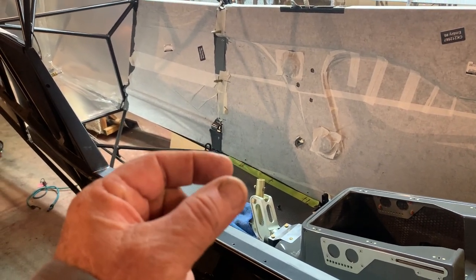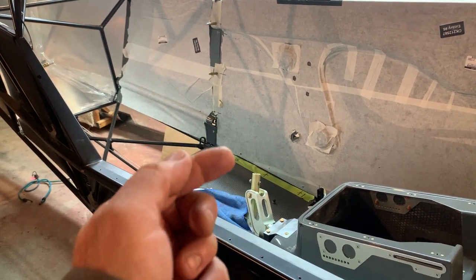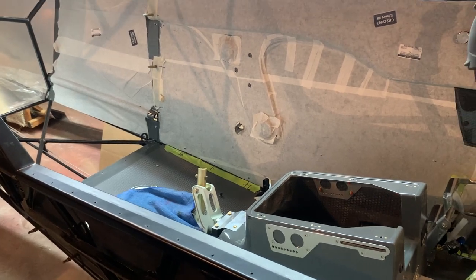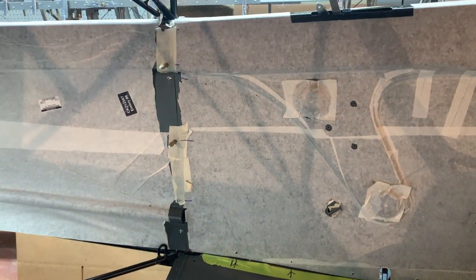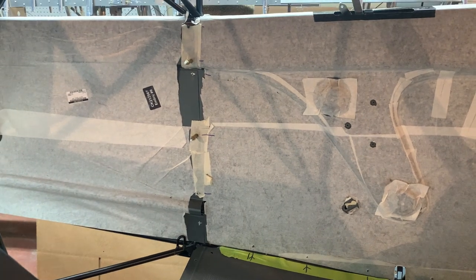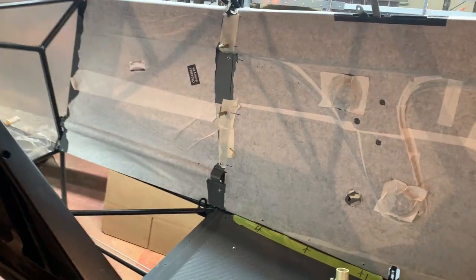They're little black plastic pieces, and they're two-part. The bottom part, you have to push it in. And then once it's all into the hole, you push the top part down and it widens it, so it holds it in place. And they are an absolute pain. I hate them. I've started going to nut plates, along with a lot of other people. So we just go ahead and install nut plates onto the floorboard and the adjoining parts, and it makes it much easier.